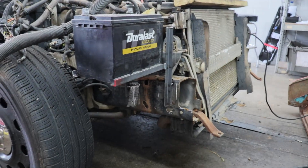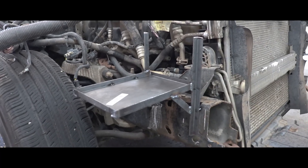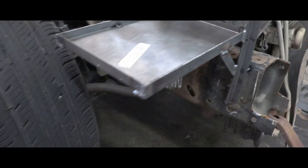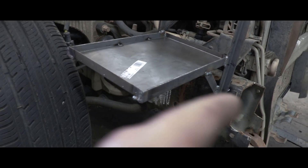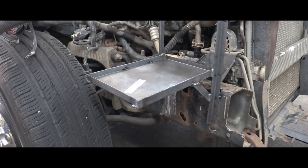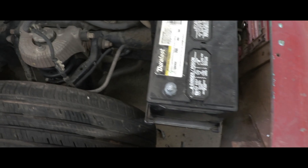The battery box is fabricated. There are a few more things to do - we're going to make some bracket tabs so we can bolt it in, then let it cool down and test fit everything to make sure the position is good. For the end here, I didn't really need that much support, so what I did was take a piece of flat sheet metal, broke the ends on either side turning them up, then welded the ends in. That kind of creates an angle iron support on the end, so we still have good support to keep the battery in place.